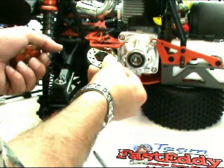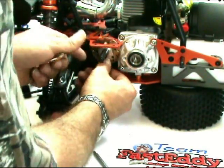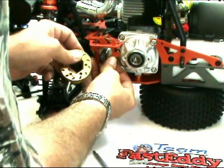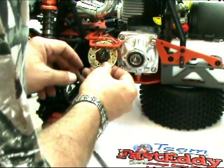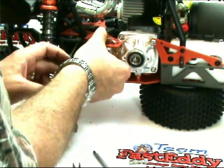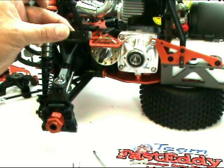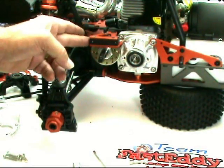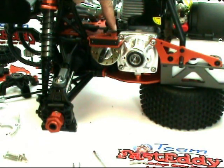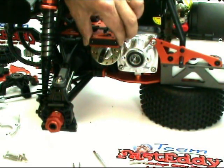Go ahead and put our brake pieces back together. And now that that's done, we're going to go ahead and reinstall our brake pads and the upper brake plate. Now that our upper brake area is set into place, we've gone ahead and put the rear screw back in, but we have left out the front two and just have everything basically just sitting here.